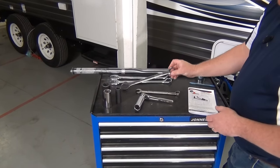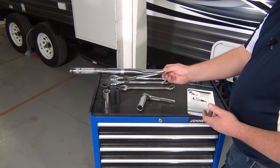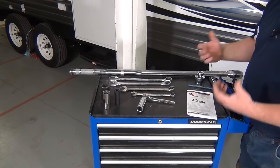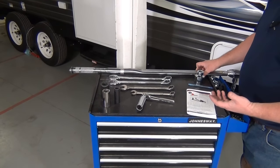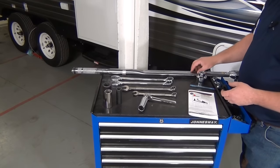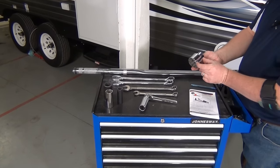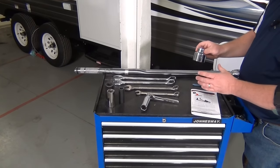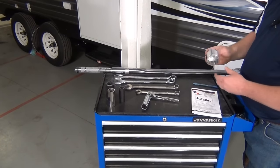You're also going to need a 15/16-inch wrench or socket — that's for your angle set bolt to tighten down and get the angle on the hitch head. You're going to need a set of 3/4-inch wrenches to do the link plates and the L-brackets; that's the hardware back on the trailer frame. If you're going to install your hitch ball yourself, you're going to need a bigger torque wrench — most hitch ball manufacturers are looking for about 450 to 460 foot-pounds of torque. And for the round bar, you need this specialty socket that we make: it's an inch and three-quarter socket, but much shorter than a standard one, with a slightly different taper so it will fit up into the round bar hitch head. Get that from Fastway Trailer Products or your E2 hitch dealer.